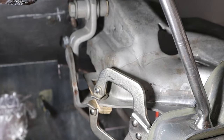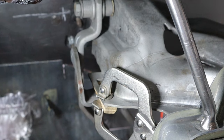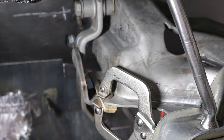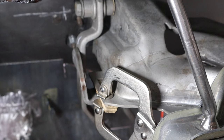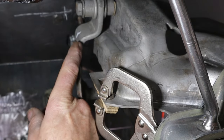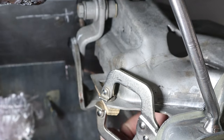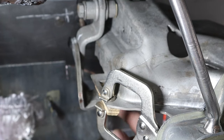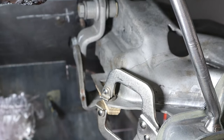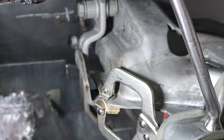I've got the clutch pedal in, and I've got a little piece of plywood clamped right there. There used to be a little rubber bumper right there so when the clutch came up it would stop instead of banging steel on steel. That piece of plywood represents the thickness of that rubber bumper. I need to figure out where this pedal normally rests because we need to cut this clutch arm off. This piece comes over and drops down - that's right where the bumper rested - then goes up near the steering column where the countershaft actuated the clutch. We are cutting this piece off completely. We do not need it - it's just in the way. We have to fabricate a new positive stop so this clutch rests in just the right spot.